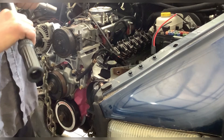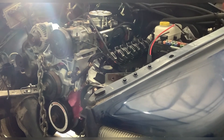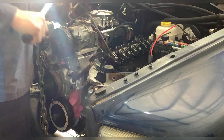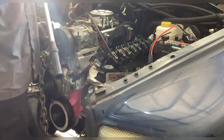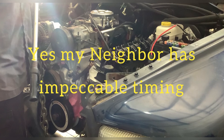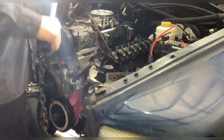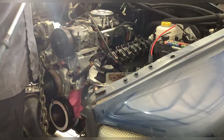The object is to shock the stud so everything will seat. I want everything to seat and move, because when you apply pressure and you get a torque reading out of it, everything is under tension, everything is under pressure. So when you torque it, everything is tweaked - to untweak it or to relax it, you need to shock it.